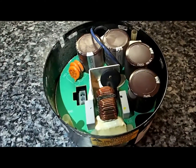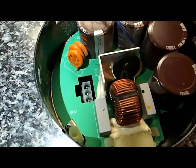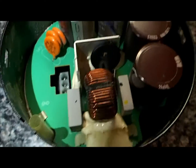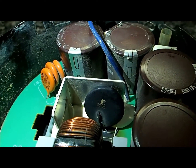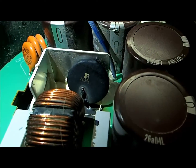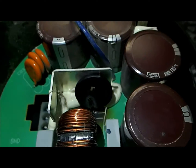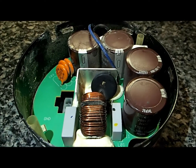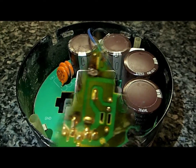You've got a couple of screws here. Now first, let's look at the actual problem. That's the thermistor — you can see that it's been clearly burnt. And that's what the problem is. We'll take the board out by removing this screw here and there's another screw in the back, plus a plastic pin holding that thing down. We'll stop the video and take the whole board out, then I'll remove the thermistor.